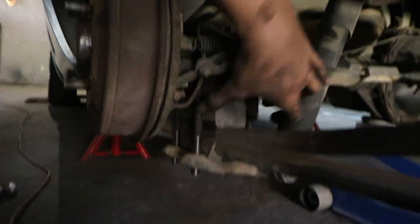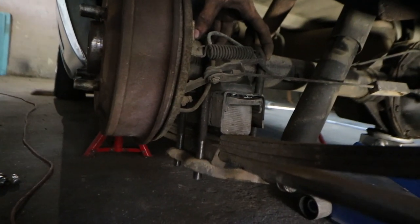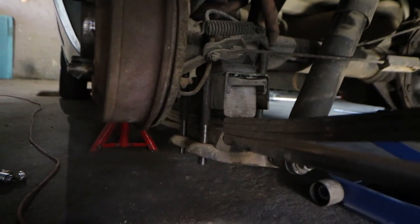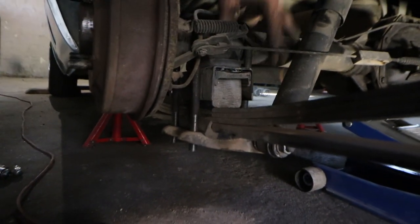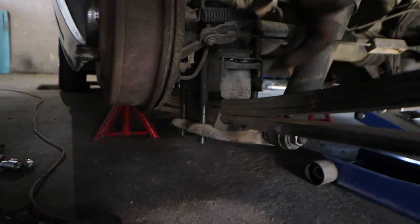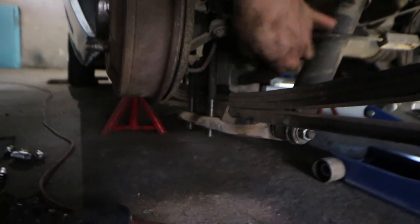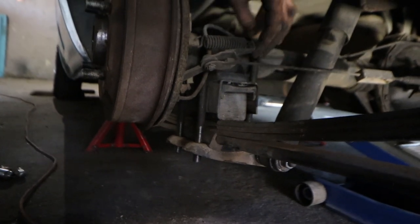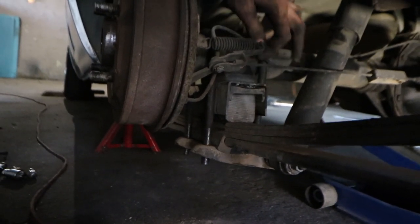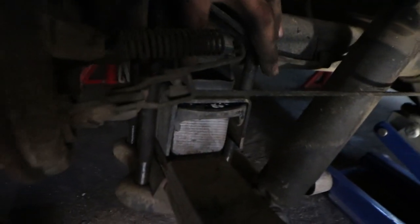And this plate is secured by the two U-bolts, and it's tightened, like it has a lot of tension on here, so nothing should happen. So meaning the top leaf spring guides the block, this metal casing goes over the block, and this rubber has like a guide coming through right here. So if you look close, you will still see the guide right there. So then it guides this axle.